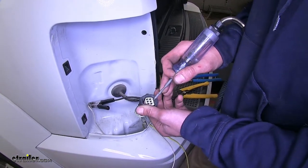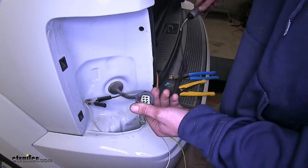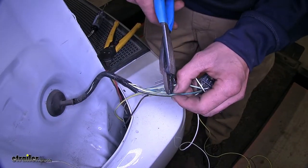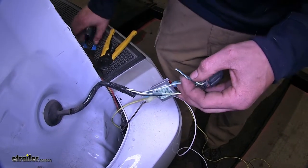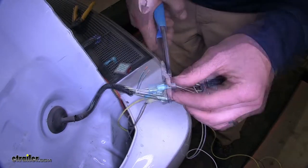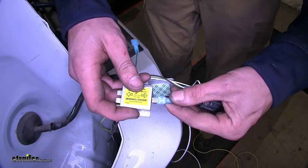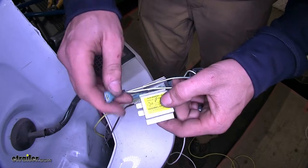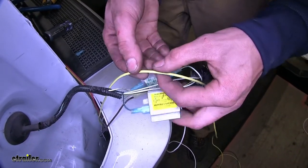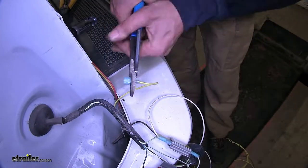Now we have an assistant stepping on the brake pedal and we'll double check to make sure which one of our terminals is for our brake light. It's the one in the middle on the bottom, which is a green wire with a white stripe. Now we'll cut that green wire with the white stripe in the middle, strip back insulation from both ends, and crimp on our blue connectors. Take another diopack — output side towards our connector, other end towards one of the inputs. Take our yellow wire now, measure off how much we're going to need, cut off the excess, strip back insulation, place on a connector, crimp it, and plug that into the other input.